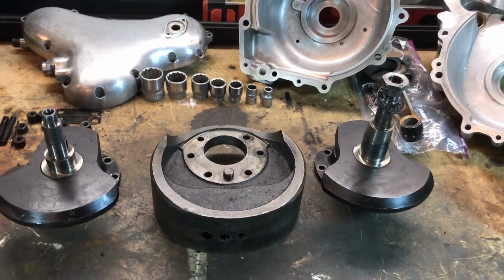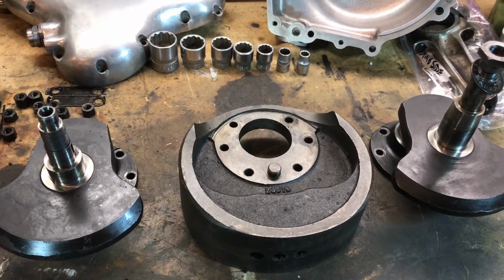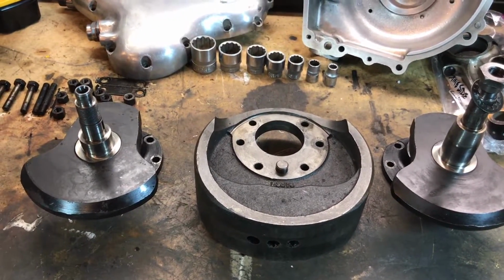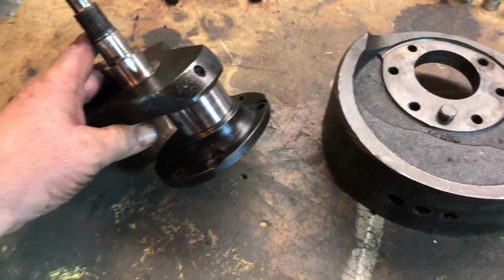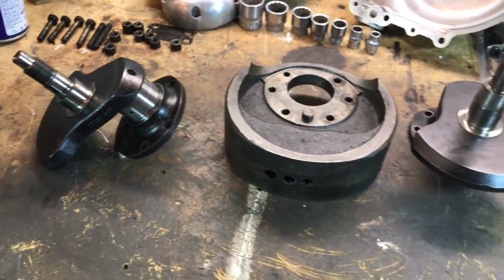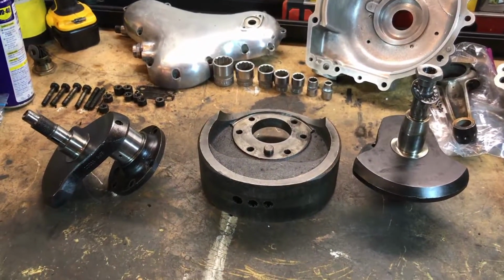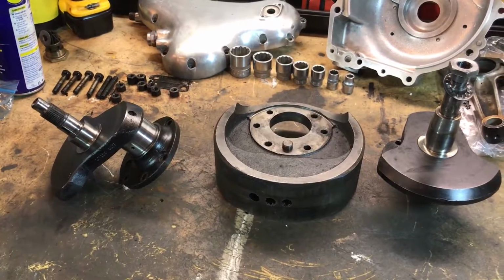Okay, so I think that's it for now. It's by no way a professional cleaning job, but I've just really wiped it over, gone through all the holes and the oil ways. For now, it will need to be cleaned professionally. And also thinking about having some of those journals ground, possibly. They look pretty good, actually. I'm not seeing any scores that I think will be a problem. Maybe it just needs polishing, and then balancing the crank as well would be a job that I'll need to outsource. I just don't have the skill or the equipment to do that, so that will be the next job, well, offline anyway. And that's it for now. Okay, see you later guys, bye.